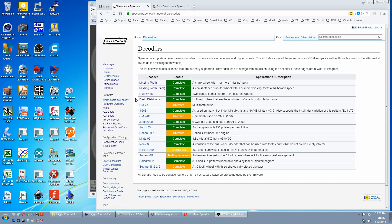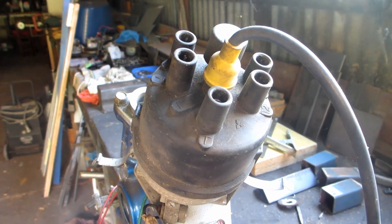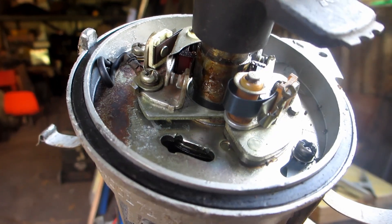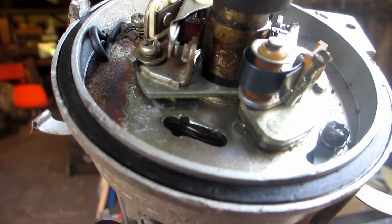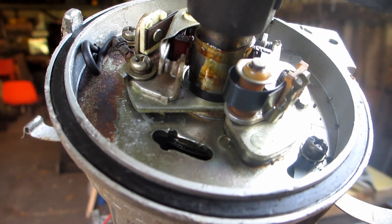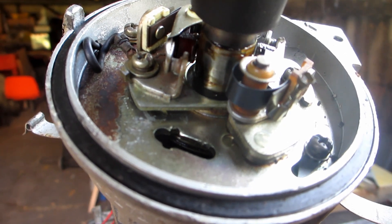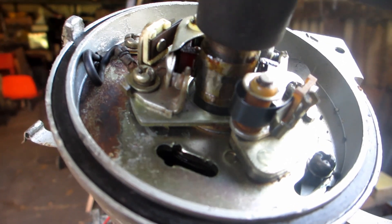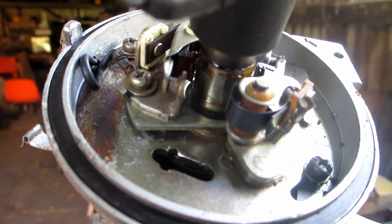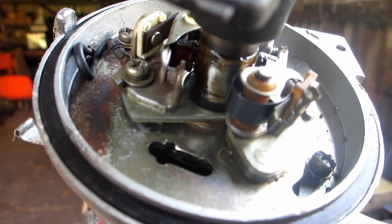In this last ignition section we're going to cover the generic basic distributor. This is not a piston engine distributor but it's the same principle. For a 4-stroke you have a shaft with a cam with the same number of lobes as cylinders, because all cylinders fire in one revolution of a cam-driven distributor. The lobes open the points — basically a switch — which grounds the coil. It's a mechanical switch sparking a coil to the accuracy of the lobe positions.